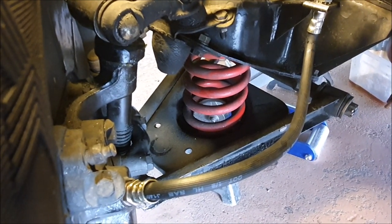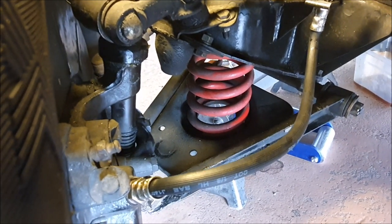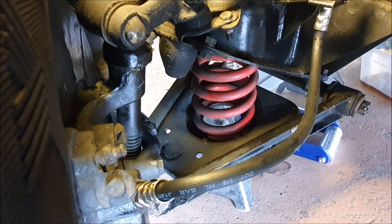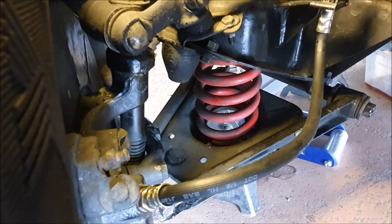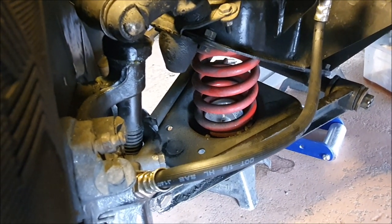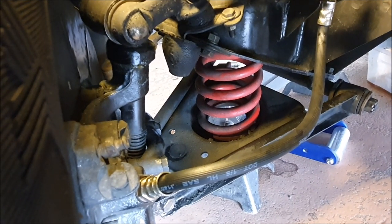I'm going to put the car down and refill the brake fluid, then re-bleed every brake starting furthest away from the master cylinder and working forward to the closest one to get all the air out. Luckily I've got one of those one-man bleeding kits.